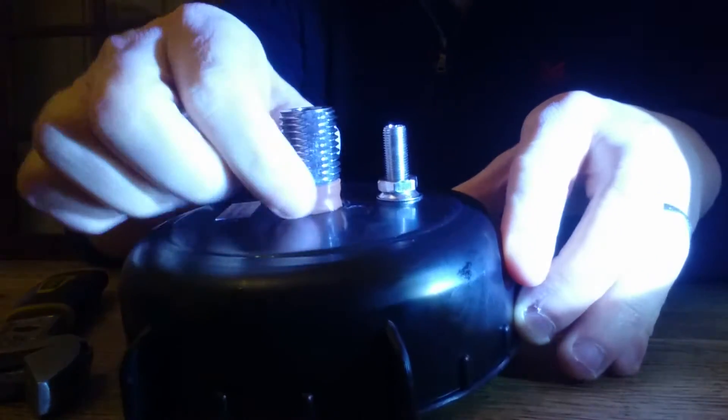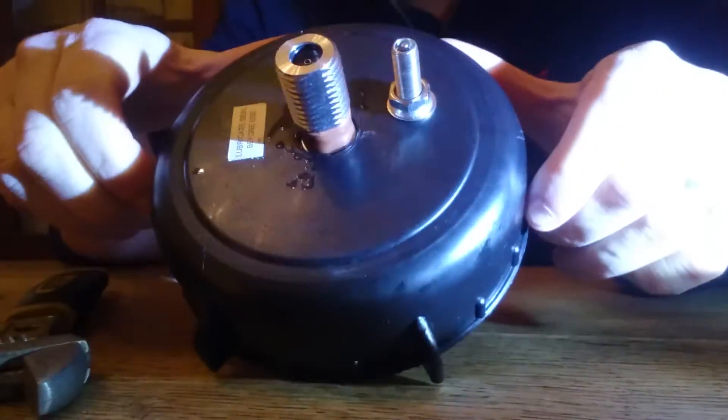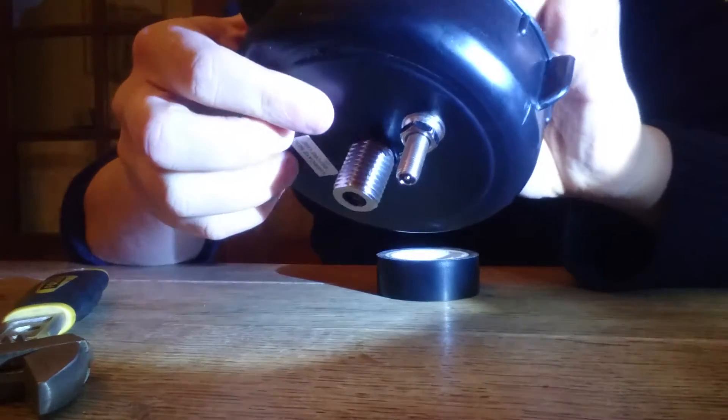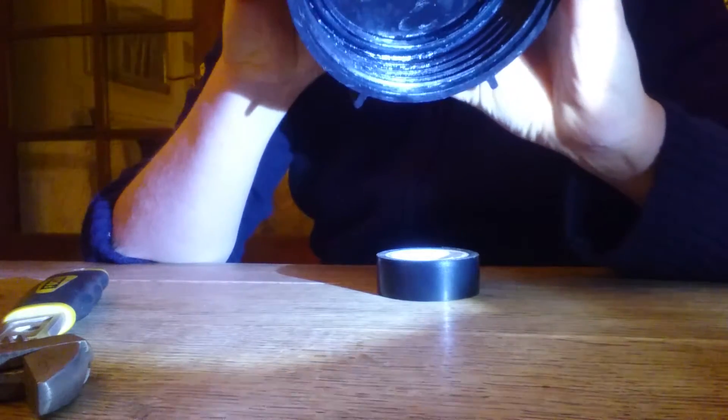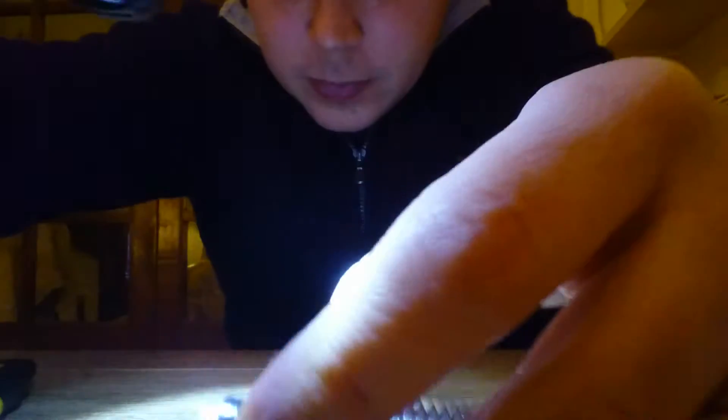What you can expect to come out of the factory is to have a brown rubber here, and that brown rubber should be rated to about 10 psi. But because it's been on there since the factory made it — and you might buy it a year after it was manufactured — chances are it's not going to hold 10 psi anymore. Over time it will degrade to the point where you should replace these every four to six months. The whole valve comes out relatively simply, at least if it's the right way around. There's the valve with the cable tie on it.